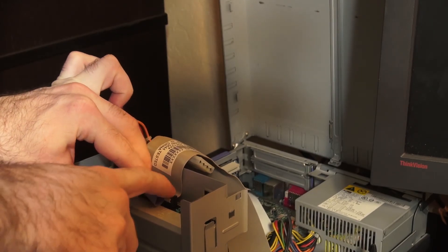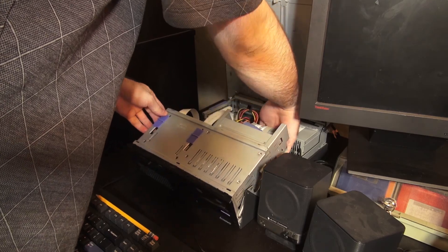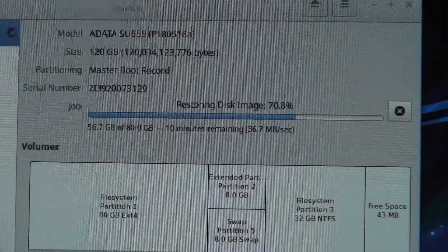I don't know why I'm plugging this DVD drive back in — it's actually dead. Luckily the SSD can just flap around. Let's compare speed. To benchmark, all I'm going to do is clone the hard drive to the SSD and compare. The two things I'm looking at is the time it takes to boot the OS, load Firefox, and finish loading my YouTube page.